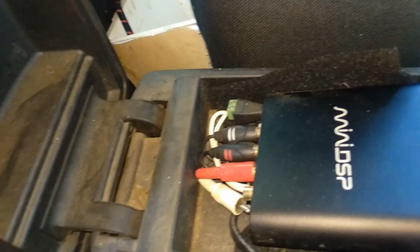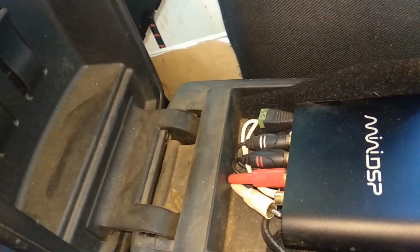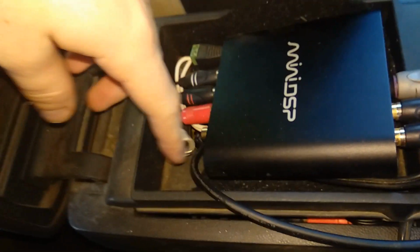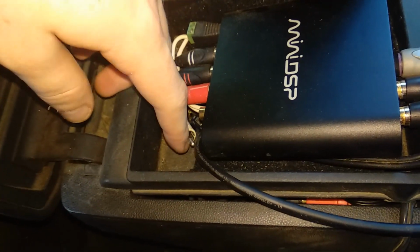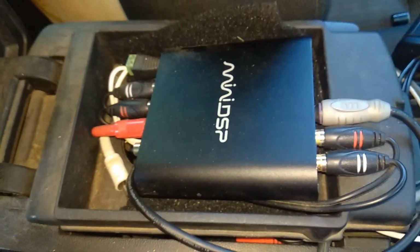The way that the amps work in the back is they sum the left and right. So if one of the cables going to them breaks, even when they're bridged, it will drop the signal by half the voltage, which is 6 dB less. So one of these cables somewhere, I'm not sure where, haven't had time to check yet, has stopped working. I'll check that once I take the sub out next time.